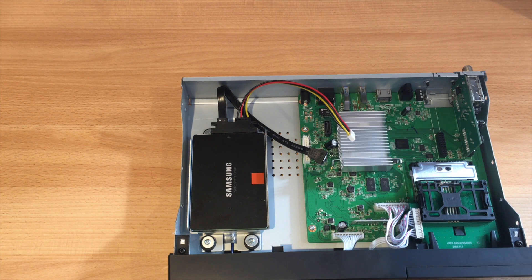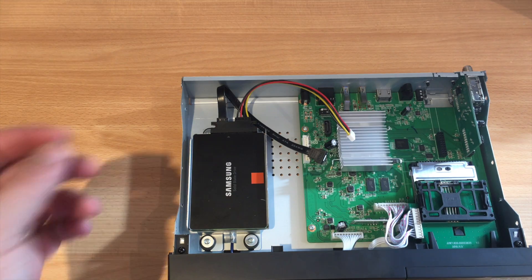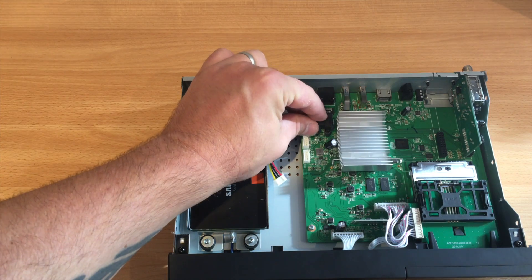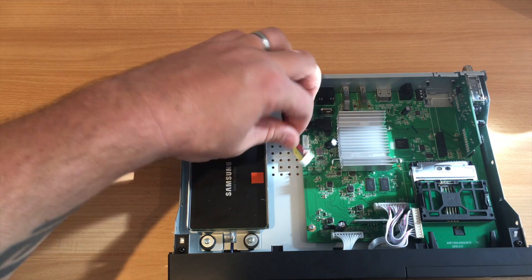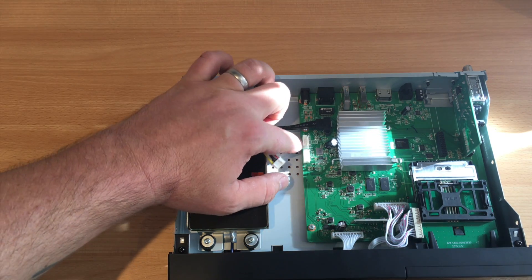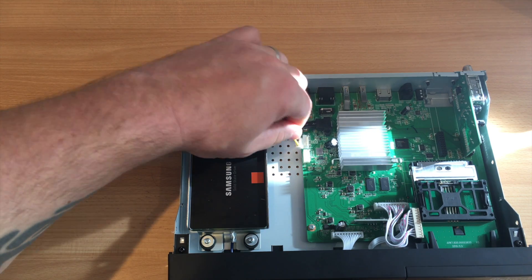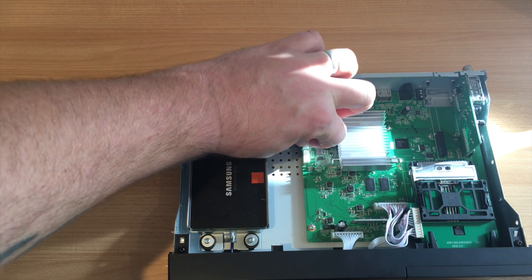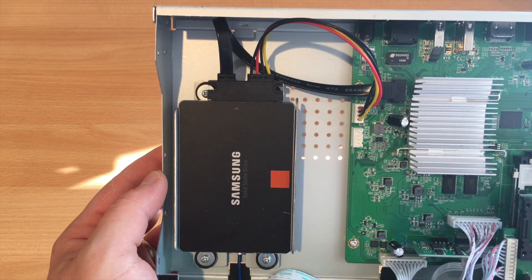I'll do this part to make it really simple — for where you need to plug in the cables. The black one can only go into one place, so push it down until it clicks into place. The next cable — props to Mutant because they've actually labelled it 'HDD' next to the connector — make sure it's the right way around and push it in. You've now got your hard drive installed and you're ready to rock and roll.